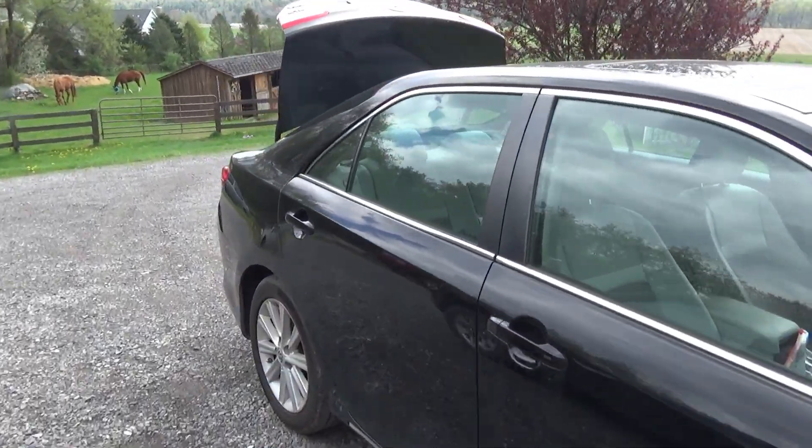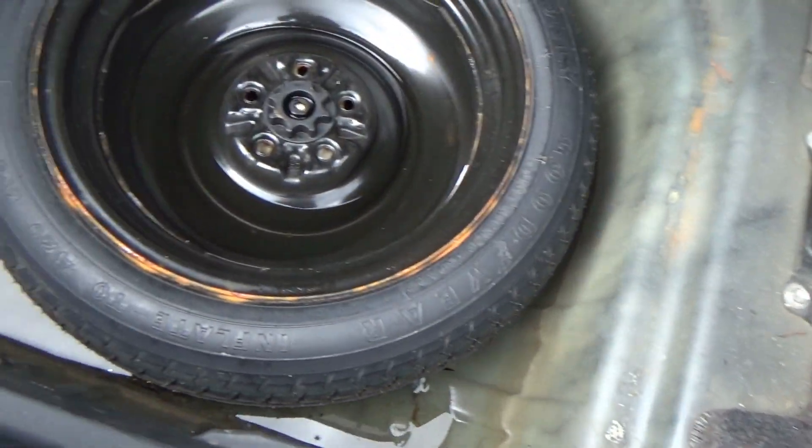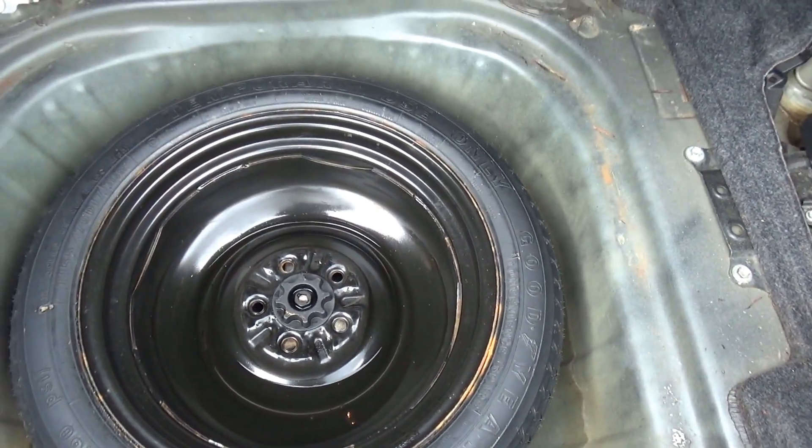Time for a little bonus footage. What was the root cause of this HV battery failure? Wires, water intrusion. At first I didn't get a clear story — was the original leak fixed? The owner tells me they didn't even drain the trunk. He said there's a pool of water in the trunk. Apparently the trunk lid was replaced, the seal was replaced, but there's still a pool of water — and sure enough, that's exactly the case. This is not good; that problem is going to happen again.